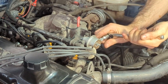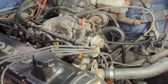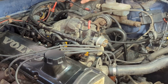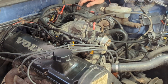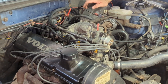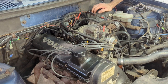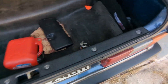I'm using the wrong fuel pressure regulator — it's a 3-bar off an LH 2.4 system, same as the injectors. It's not intentional, I just had it on there by mistake. I needed a 2.5-bar one. The problem is finding them — hard to find used, and new they're over 100 euros. So I need to get one because this isn't correct; it's too much fuel pressure.